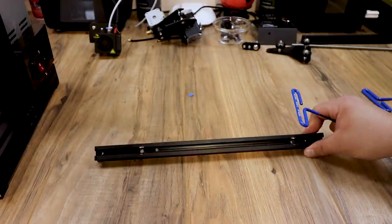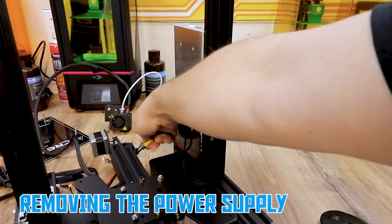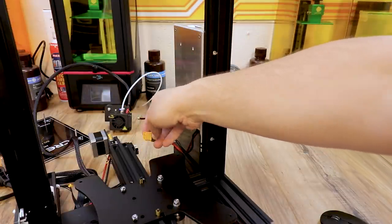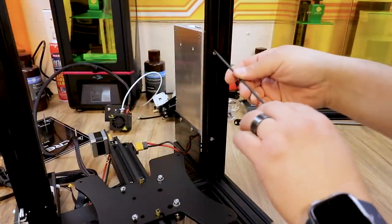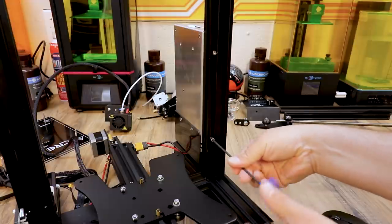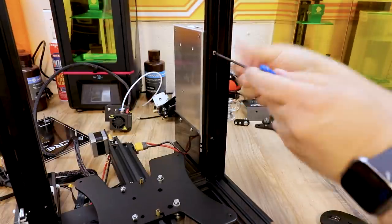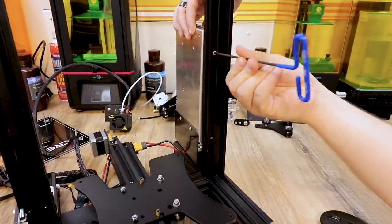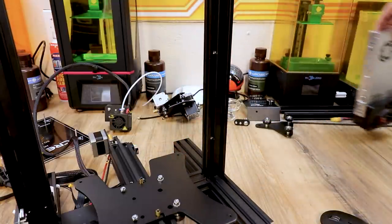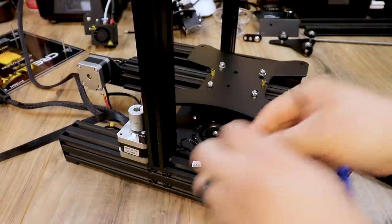Set the carriage in the back and throw the old x-gantry bar in the back as well. Now take the power supply off — go to the back and disconnect your XT60 connector. Then take your Allen wrench and take the bottom bolt off first — this should be the Mean Well power supply since this is the Ender 3 Pro. Save those bolts as we'll use them later. Hold the back of the power supply so you never strip the case, pull that last bolt, and put your power supply aside. Now remove the Z end stop — just these two bolts with T-nuts — and set that in the back.